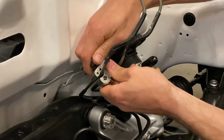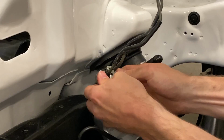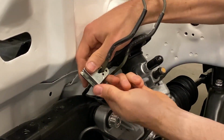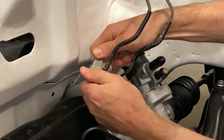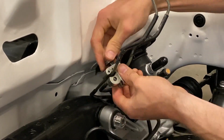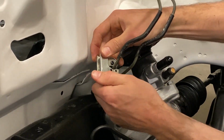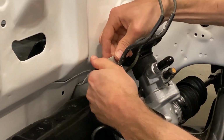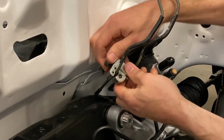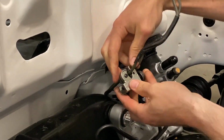And you will just rotate it around the tube, the brake line. Each time, or sometimes sooner than each full rotation, you'll be able to snug that wheel up just a little bit more. It's going to bring the blade closer and closer to center, which is going to cut the brake line off.